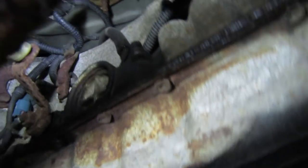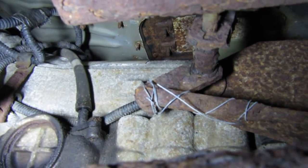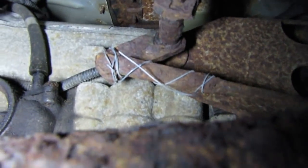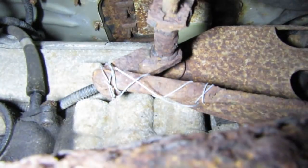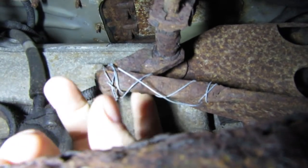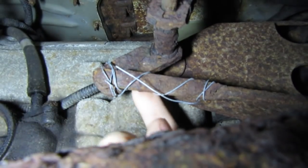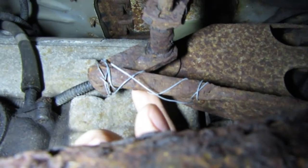What had happened was the grommet that holds the arm for the lever to the arm for the actual shifter selector had dry-rotted. It's not an uncommon issue — happens a lot on kind of all Jeeps. I've had it happen on WJs; this is the first XJ I've done. You can see this is the arm that goes to the transfer case, this is the linkage that goes up to the selector lever, and right here there'd be a grommet holding this arm to all this. It dry-rotted out, fell out, and I had to wire this arm to this arm so that I could use my four-wheel drive in the meantime.